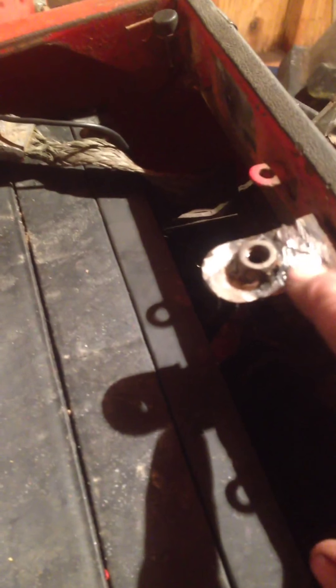Got the new battery door for it. The original battery door clipped down like a mailbox latch — you push in and latch down. I tack welded this piece on it off another bracket off something, and tacked that nut to it. Now the battery door actually just clips into those little ears — it's got two little ears on each side, it goes into little slots. Clip it in. Hard to do one-handed here. Tighten it down like that with a bolt to keep it from flying off.